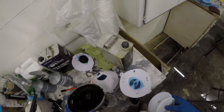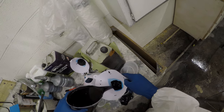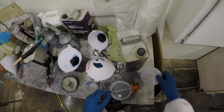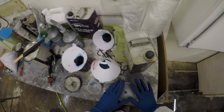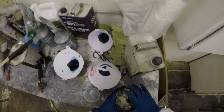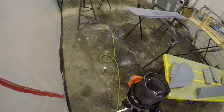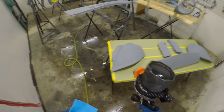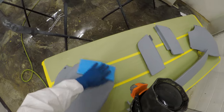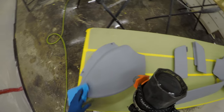We're doing a base coat clear coat job for this 280Z, so that's very important to get all those settings proper before you start spraying the entire car or panel by panel, whichever you may be doing. In either case, you do not want the base coat going on thick. You want it very, very thin on each successive coat, and apply enough coats, after they've allowed proper time to flash in between the coats, to get the color coverage that you need.